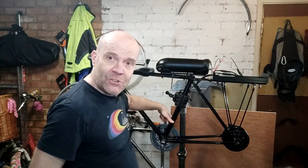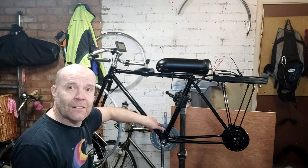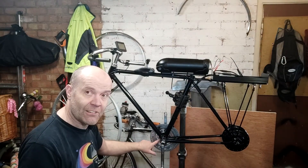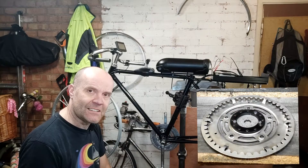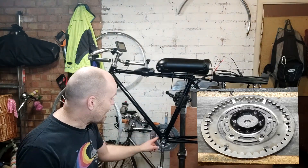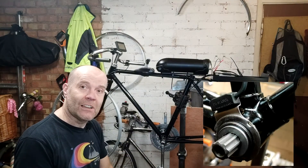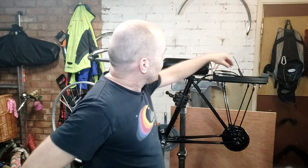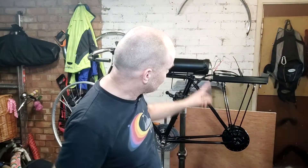On the crank here, there's a little wire behind there, and there's a magnet mounted to the chain ring — I drilled and tapped that magnet to the chain ring. As the pedals turn, the magnet turns, and there's a little sensor which picks up those magnets as they rotate, giving a pulsed signal which goes all the way up this wire to the main controller. That tells the controller that I'm pedaling and I need assistance, and my assistance level will be set and displayed on screen using my little push buttons.